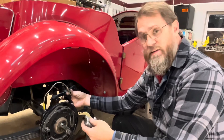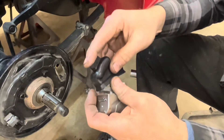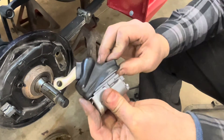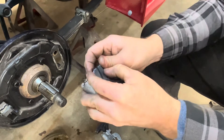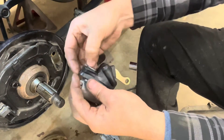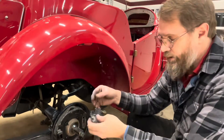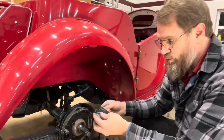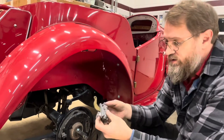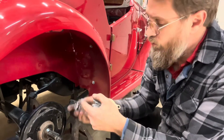Before you actually bolt any of this stuff on, you've got to put the boot on first. Once it's back there you just get this boot slid through there and then you're going to pull that up over the top against the back side of the backing plate. Then this is going to actually go up under here where there are slots it goes into. It's much easier to show you that here than to try to do it back there when you're fumbling around. I think it's a lot easier to put these in by just taking the piston out so it's not getting in the way.